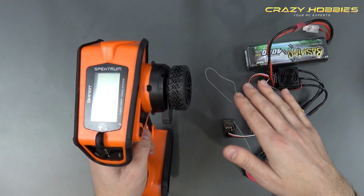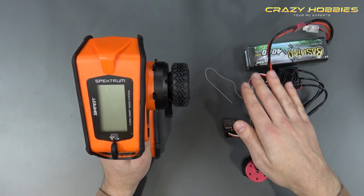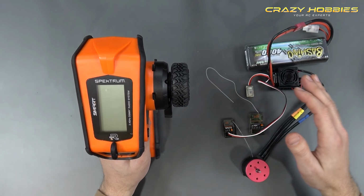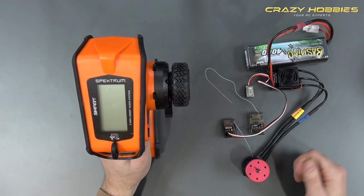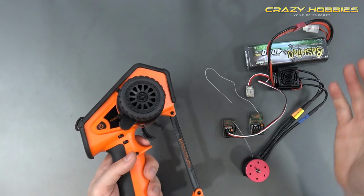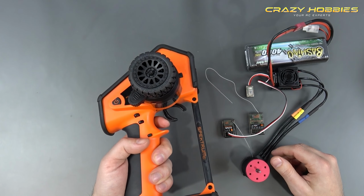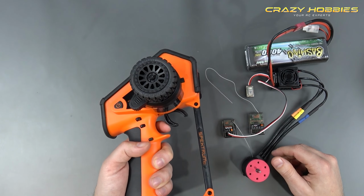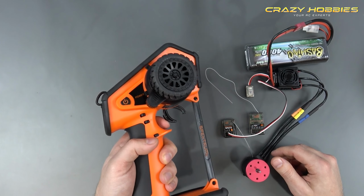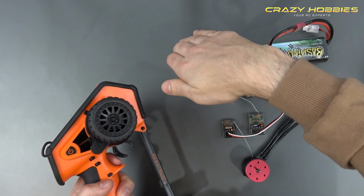And then it should hit the brake. So before you take it outside, make sure you test it on a bench first before you drive it, or else you will have to set the fail-safe again. And if it goes into full reverse, then something's not right. You can just, instead of going all the way brake, just go a little bit, right? So when the controller switches off or somehow, it will just come to a gradual stop. It won't just lock up the brakes.